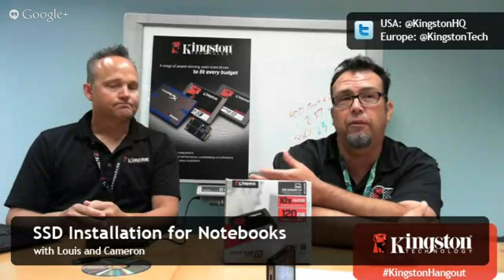Cool. So we talked about that. One of the nice things, along with how easy it is to clone, is that this Lenovo, probably in a couple of years, I'm going to want to replace it. Do I have to throw away the SSD? No, you can still use it. Chances are there's lots of endurance left. We have tools that ship with the driver that you can download to query the life left on that SSD. If I'm at 50% plus or probably more, there's no reason to throw that away. If I upgrade to the next ThinkPad or the next MacBook, just reclone and keep going. I don't have to eat that SSD. The serial ATA interface isn't going anywhere anytime soon.